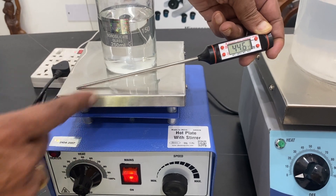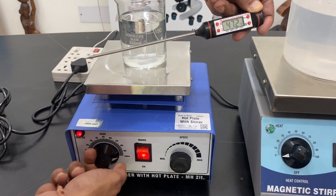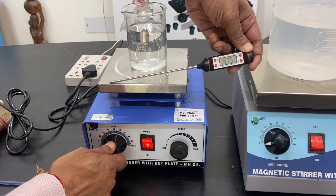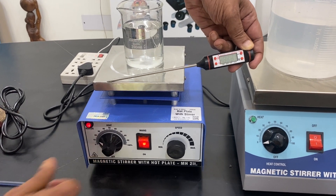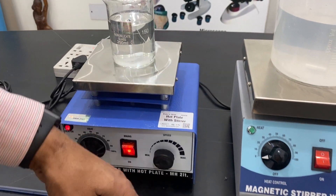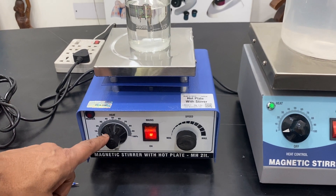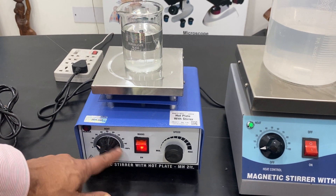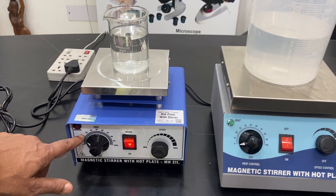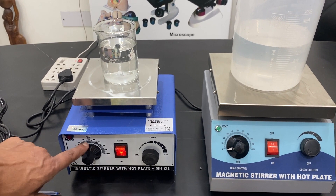This is only a heat regulator — it is NOT a thermostat. The temperature can go up to 100, 120, or even 150 degrees. Never run it on 100. Even setting it to just 10 on the dial, the temperature was already increasing to 40 to 60 degrees. Be very careful: the numbers on the dial — 10, 20, 70, 90 — are the speed of heating, not the actual temperature in degrees.